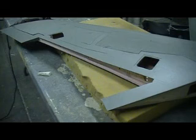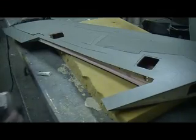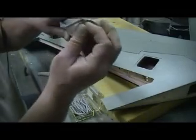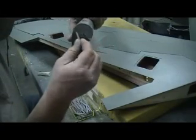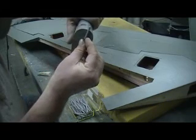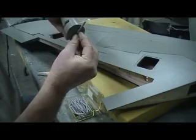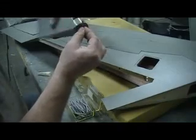I got one hinge there but I'm going to put another one. I wanted to go over some hinges with you guys. Most people that build jets know how to do this, but I've seen some jets that weren't done right. You never under any circumstance take a round hinge and put that hinge out there. What you want to do is find your center, your equal distance in all those places - bam! That is your hinge point. That's where that pin needs to be, way inside there. That's how you get that full rotation - you see how that rotates and it stays at the same thickness. That's the purpose of that gapless hinge.